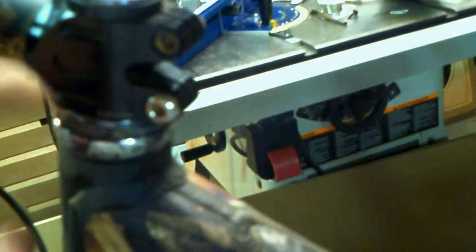So these are a dual air configuration. They made the Pikes in a lot of different versions, but this one has no spring in it. The one I had prior to this did, and these are super ridiculously light. This particular frame has a very tall neck, and of course the steering stem on the fork ends up being a lot longer, but you can see that there's no spacer underneath here. I used to have it, but I don't have it anymore. In fact, I left one spacer on the top, so this steering stem is down all the way on top of the headset bearings right here.